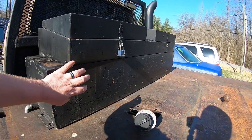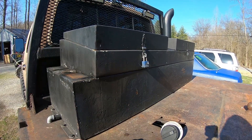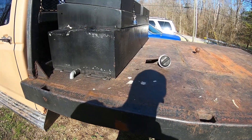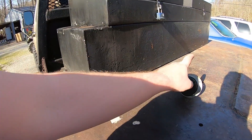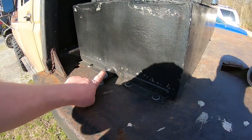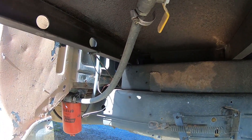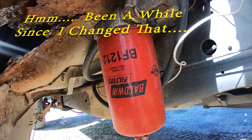As you can see we've got a bed-mounted tank back here. The fill for the tank is actually located in the toolbox, and we've got the stock tank which the previous owner ran the fill up through the bed instead of through the side — something I've got to fix later. This is an approximately 50-gallon tank and then we've got the factory side-mount tank which is 19 gallons. We run out of the drain on this tank to do a gravity setup, which comes through here to a valve and then half-inch B100-rated fuel hose down to our fuel head.